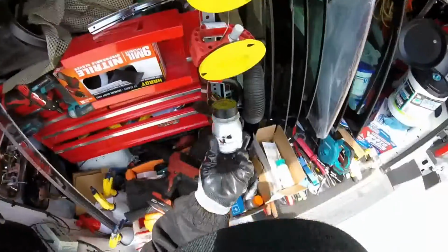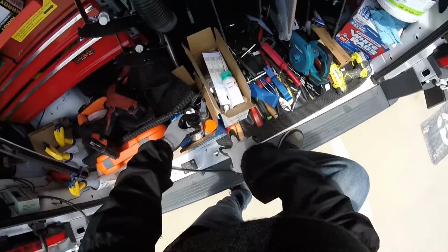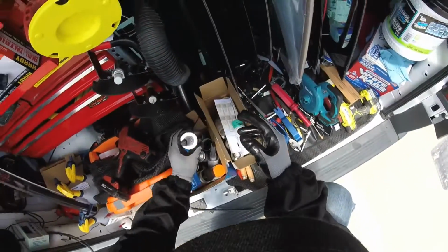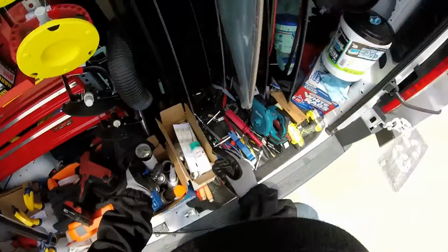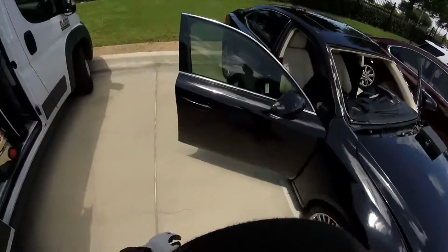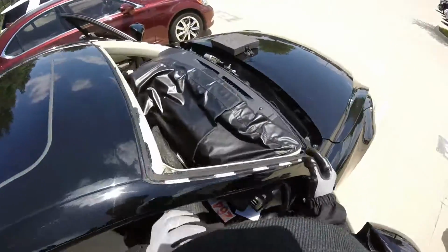And your 207 with Sika. Now remember, both of these are primerless, so that means you don't need a primer, but still you need it. No matter what, believe me, you have to use primer. It's the best attachment. I already made some tests on other cars, and I was using my P2G with no primer, and I don't think it's a very strong bond.